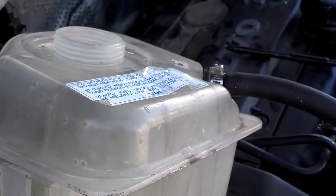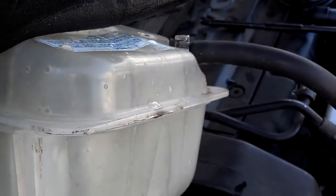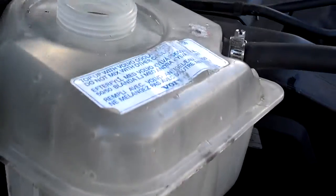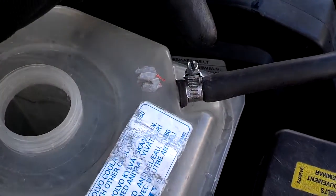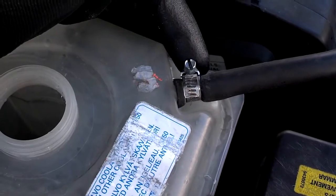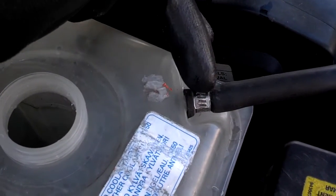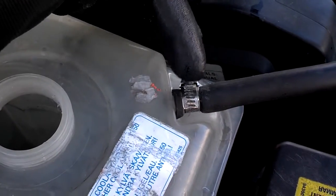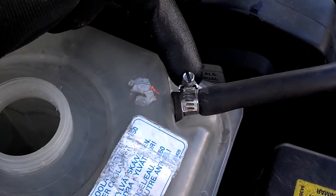I'm not sure about the aftermarket bottles, but the good thing about the Volvo bottles is they have a metal sleeve in that neck, and a metal sleeve in the neck of this connection down there. One of the fallacies of connecting these hoses is having a clamp small enough to actually seal that off. This is a pressurized system, and oftentimes this hose connection there is not tight enough, and air and coolant seeps out, so you've got to make sure you've got a clamp small enough to tighten that up.